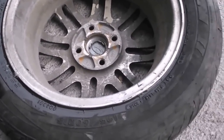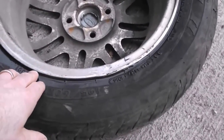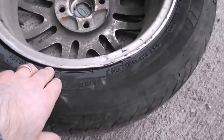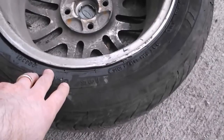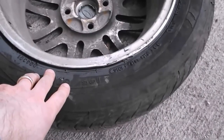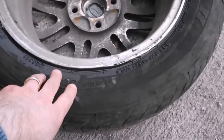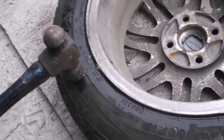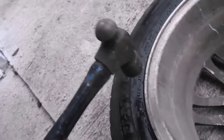This is the conclusion of the job that was to keep air inside the tire. After checking it again I could find very small bubbles — it even seemed okay at first, but then I came back about 10 minutes later and could see some frothing around the edge in two or three spots. This time I took the air pressure down to about 10 psi and tried my last trick to get this tire to seat properly: I pounded on the tire all the way around the rim pretty aggressively.